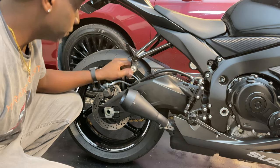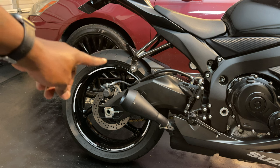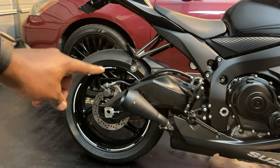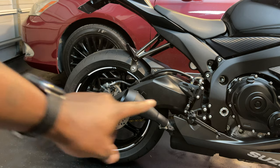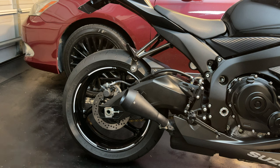And that's that. So this is how it looks now. We are gonna start it up. I'm probably gonna go ahead and tighten it down first, and then do the start so we can get the nice clean finish with the heat shield back on and everything, and then we'll get it started up. But very simple, easy process. Basically, the top bolt was holding on the muffler because it's so long, and this one doesn't even need it. Then you have one bracket at the bottom that holds it on, slips right off, you slip the new one on, and that's pretty much it. So that's the first mod. We're going to get it all put back together with the heat shield, and then we'll get it started up, and I'll do a side-by-side comparison so we can see the sound differences.